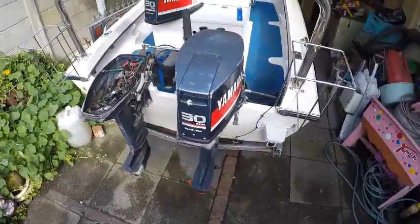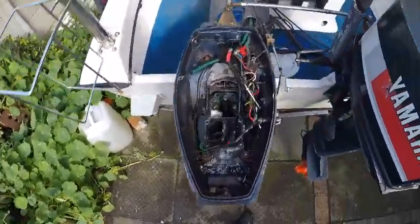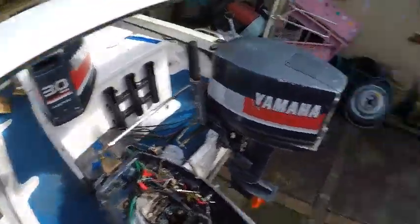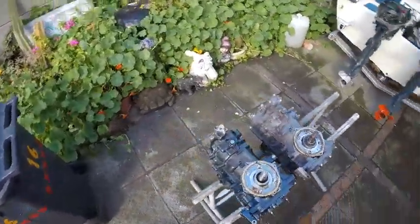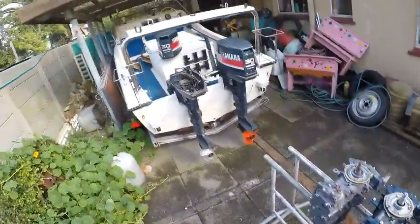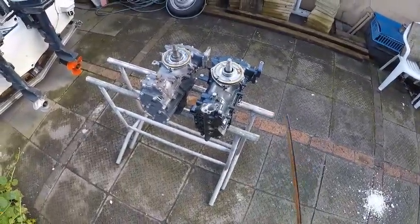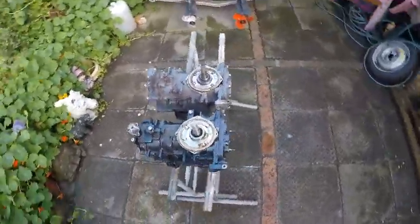After running these motors for a few months, I found that this one was suffering from severe corrosion causing overheating. This was all the crap that came out of the engine. I found that the inner lining of the block — the entire water jacket — actually separated from the cylinder, causing the motor to overheat sporadically. It would run fine and then overheat, and the entire inside of the block is actually cracked. That's this one — it's a 5689, which is the old 1986 block.